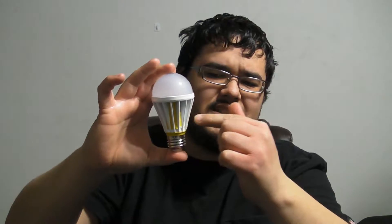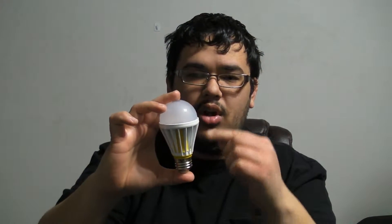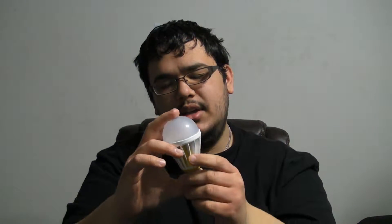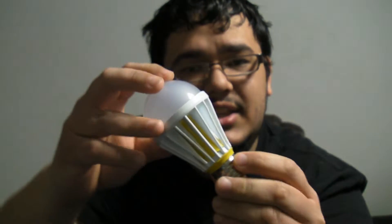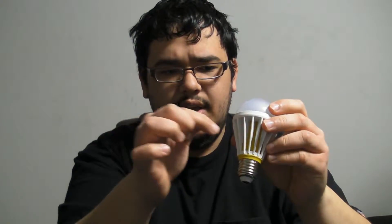There are a number of reasons for that. First off, the magic happens inside this case — the things you can't see. It has a super high efficiency drive that produces less heat overall on the inside, and less heat means less strain on the components, so they last longer. Every LED bulb has a heat sink, and you can see clearly from these fins. One thing you might not be able to see on camera is that these fins are not directly connected to the rest of the casing — this yellow part in particular. By doing that, what I assume they're going for is that airflow is now not restricted to just go in and bounce off. Airflow around the bulb can flow nicely through each other, giving somewhat of a passive cooling technique that not all LED bulbs seem to use.